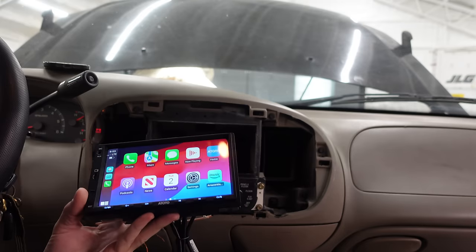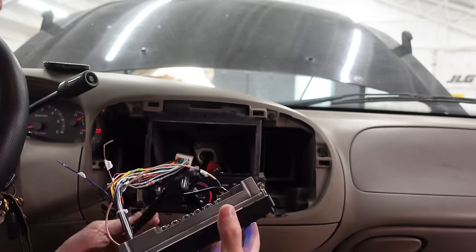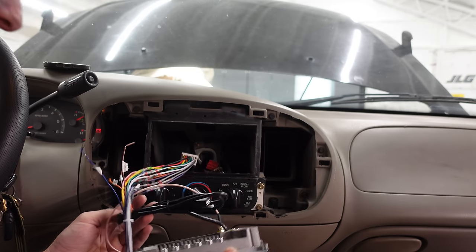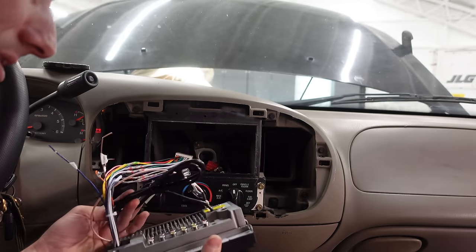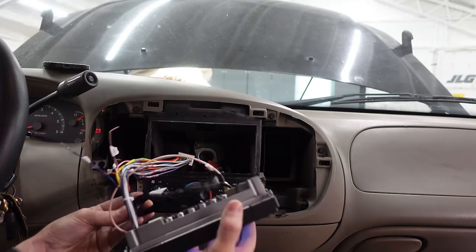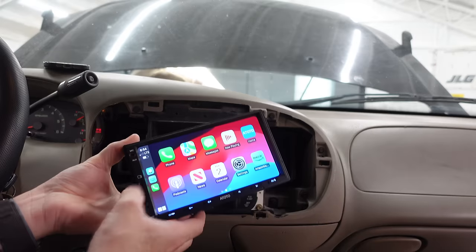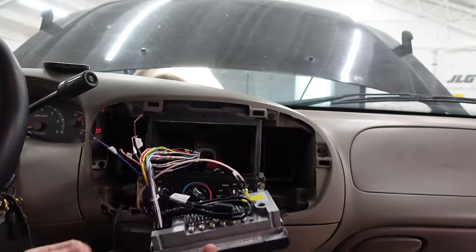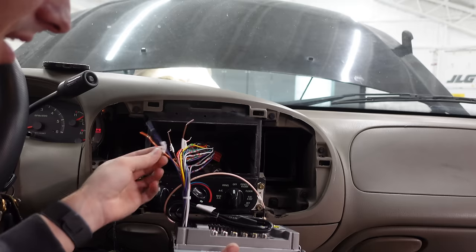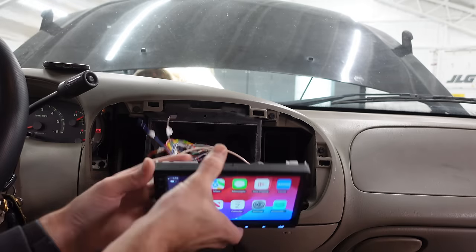Usually people stick me with backup cameras and all kinds of stuff, 360 cameras. Today, we're doing the simple one. I do need to add the microphone for Bluetooth and then cut the wires out that ding when the seatbelts aren't plugged in. Because come on. That is outrageous. So we'll run this USB cable down somewhere, even though it's got another port on the front, and hook up the antenna, and that's it. These wires get cut. We'll just trim them right there in case we ever need them in the future, but they're amp turn on and stuff like that that this truck doesn't have.